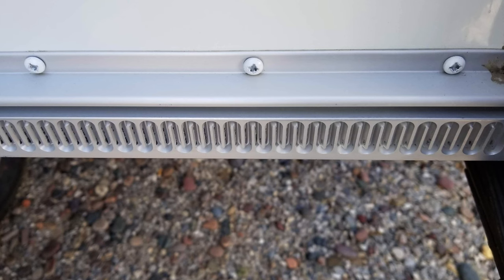The other thing I wanted to mention is that sometimes on slides, the manufacturer even forgot to put sealant or butyl tape behind some of the mechanisms. There's an area along the side of the slide — and hopefully I can show you a picture — where I often find there is no silicone sealant and water can get in through the screws. Any area where there's a possibility of water getting in, water will get in. Make sure those areas are covered to prevent water damage.